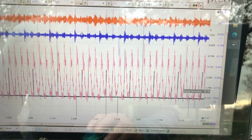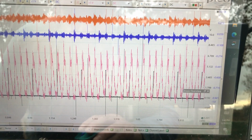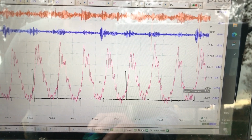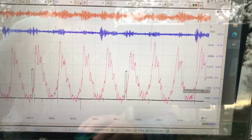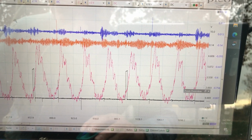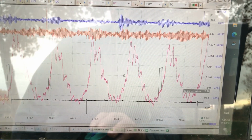And we don't have an abnormal engine noise. You can see, as I mentioned earlier in the previous video, we usually see 4 normal events in a fire cycle, because we know there are 4 combustion events. But see the relationship between the 2 microphones on top of the cylinder head. This is TDC for cylinder 1. Let me zoom in even better.